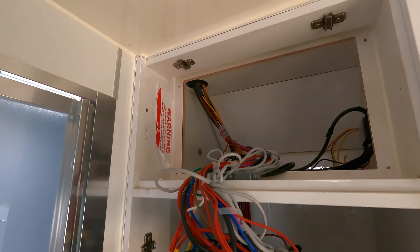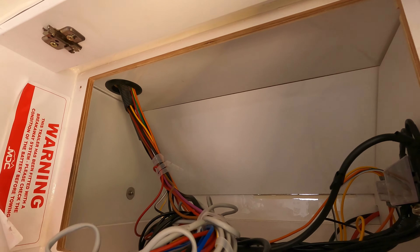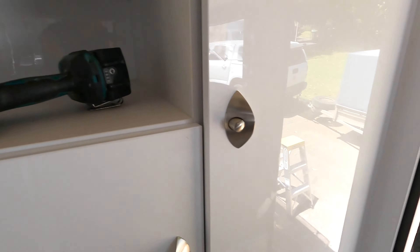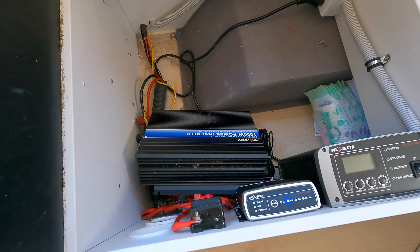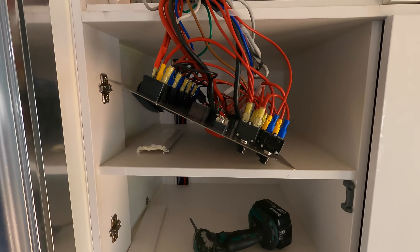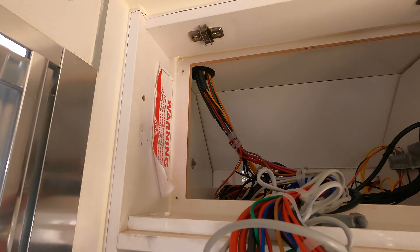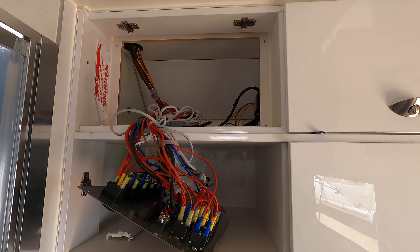The next part is seeing where you've got to come through the roof. I've come inside the van now and this is where we're going to come through. There's already a grommet in the underside of the ceiling, and then it's going to come down the cable tray and across to this side of the van where the DC charger is going to be. It's a bit of a mess but we'll sort this out. I'm going to go up top and drill that hole through, fix a bit of silicon around all our angles up there, and then come back inside and run the wires.